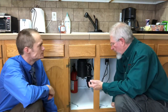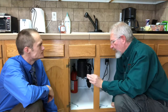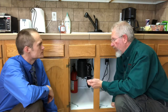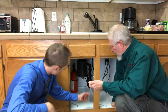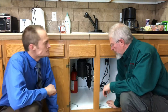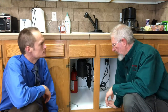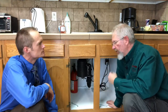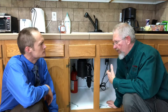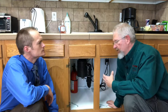The reset button is at the disposal — it's a real small little square button, used to be red, and you can depress it kind of like a GFI or a breaker switch, on the very bottom of the main unit. Usually when you push that in it'll reset it. If it resets and you can hear a sound the next time you turn it on but it's making more of a humming sound and not turning like normal, that means it's probably jammed.